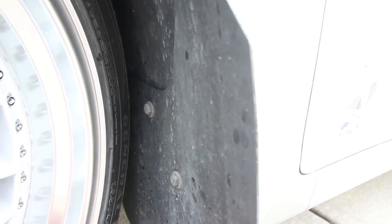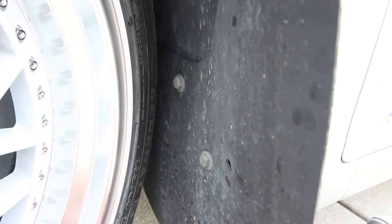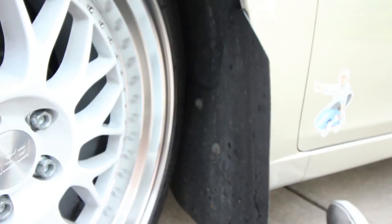So that's literally how simple it is — you just mark your holes, drill, and put your bolts in. These mudflaps are really cheap, like $25, and then the hardware is probably like three or four dollars for eight bolts, sixteen washers, and everything you need. Something else you should do when installing these mudflaps is stack them on top of each other and drill the same holes out so they're even on both sides. Then try to get them as close as you can away from the ground so it doesn't look off when you have them on.